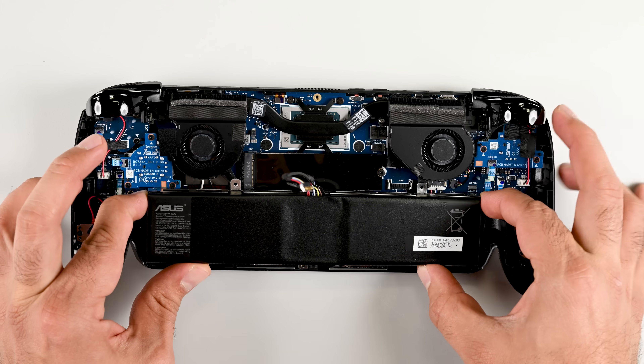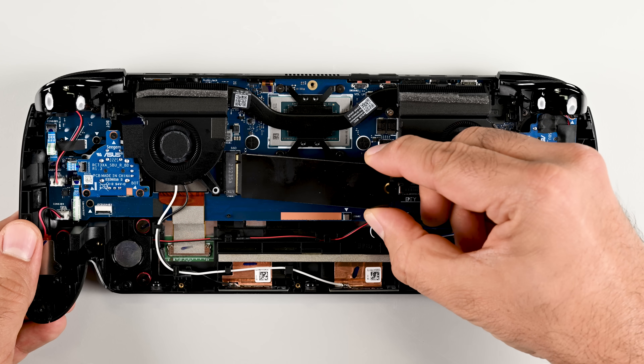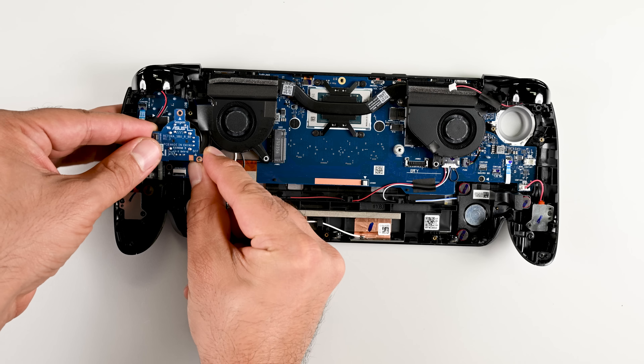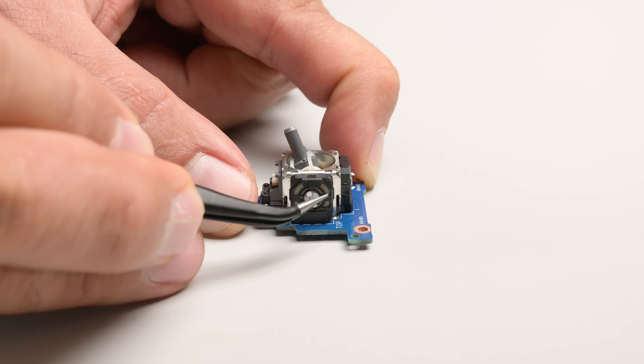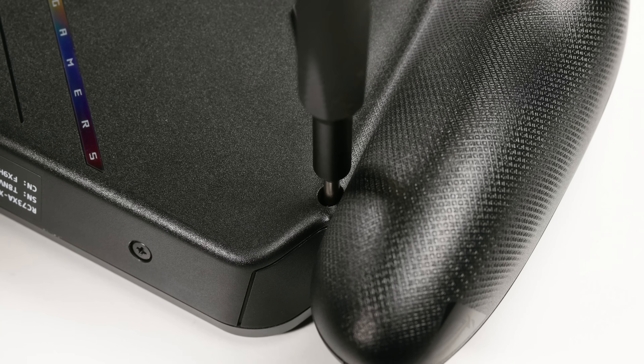So there you have it: a very accessible and easily removable 80Wh battery, a socketed 2280 NVMe for storage, modular sticks that are easy to replace though cursed with the drifting spell, and a one-Phillips-bit-fits-all design that makes service and repairs a breeze.